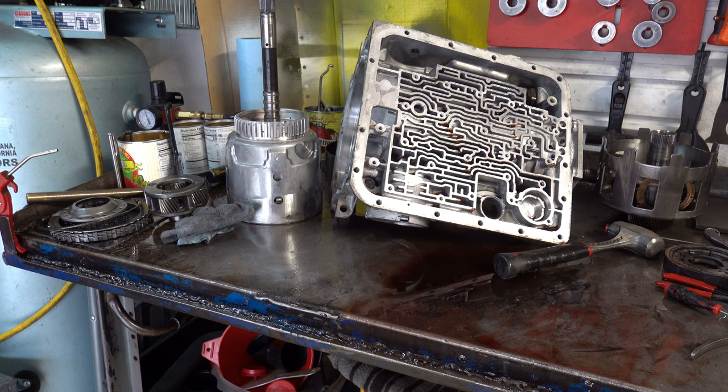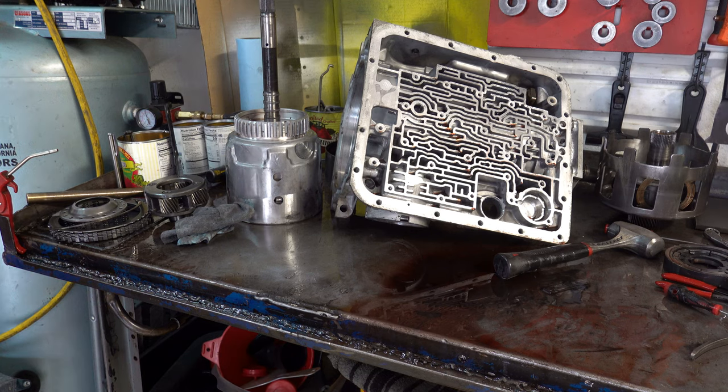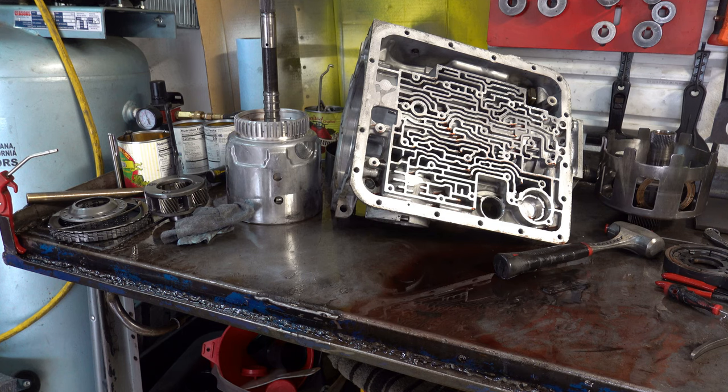And, you know, the closer you are to that 35 thou mark, the better. Some guys will run them down as tight as 30 thou. I know Alto in their max pack instructions, or some of their instructions, tell you to run it down to 25 thou or something like that. I never did that. To me, that's a little too tight.